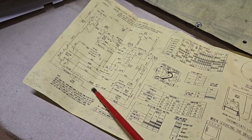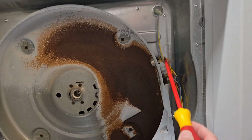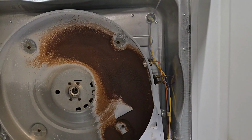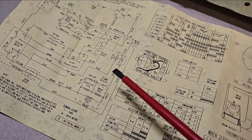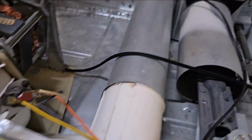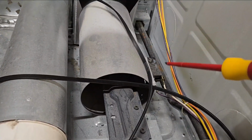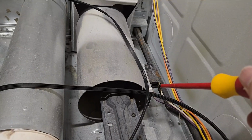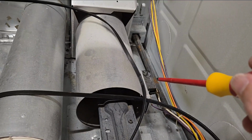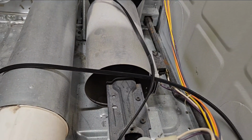The next item that we're testing is this safety switch. We find it with the orange and yellow wire. That is right here in the back, and that also tested good as well. The flame detector is a little sensor that's right here. It has a little viewing port in there, so it detects whether there's a flame. In our test position, the off position, if you remove the contacts, you should also have continuity, so that switch should be closed. And in our case, that is working.